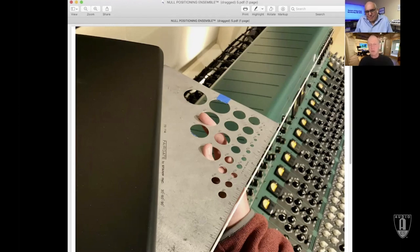Now, that said, you're not going to do this in 20 minutes. It's tedious, I promise you. It takes us an entire day. We use a laser quad system, but you can get it using a tape measure. Make sure your speakers are the same distance from the front wall, obvious things. And it's a seesaw thing. When you change the angle on one side, that's going to change the distance. You're going to lose your 67.5 inches. So you're going to be seesawing between the 67.5 inches and the 30 degrees. But eventually, it might take an hour or so to get it exactly right. Get your height right, and I can promise you it will be dramatic as far as your imaging is concerned.